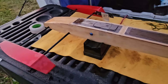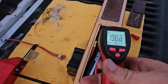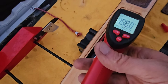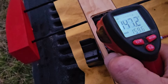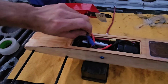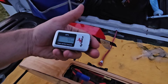Let's open it up and check. Not bad. Motor's hot — yeah, motor's hot. Actually that might be the wires because I'm directly on the motor right there. EC3 is warm, probably the battery: 129. Let's see what this ABC prop did for speed — even though we know we're not really getting anything good out here because of the grass. 55 mph — yeah, it was slower, I could tell.